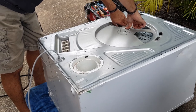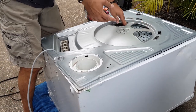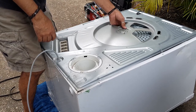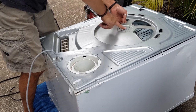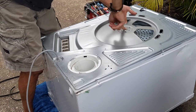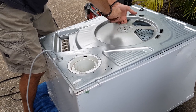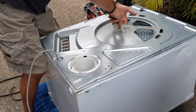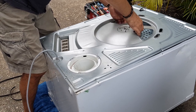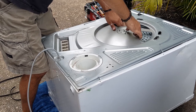that pin on the drum goes straight through the bearing. But listen, before I even do that, I forgot to do this: I like to put my finger on the bearing and move it around and make sure the bearing's moving nicely and freely. This bearing feels really good. I can even spin it like that and it spins. But if it feels crunchy or it doesn't turn when you're moving it, replace it. Definitely replace it. But that feels good.